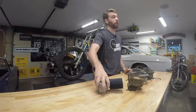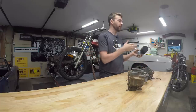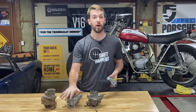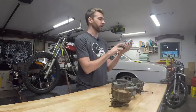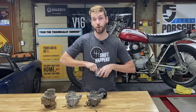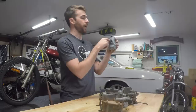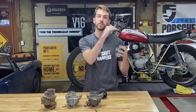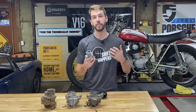What I've got here on the table is the carburetor off this SL as well as a couple others that are off automotive applications, so I can show you how they relate and also what is different between a motorcycle carburetor and some automotive carburetors. At its core, a carburetor is very simple — all it needs to do is mix air and fuel as it goes into the engine. It needs a float bowl for holding fuel, and a venturi, which is a narrowing as the air comes into the engine that pulls fuel into the airflow, mixing it and creating something that can combust in the combustion chamber.